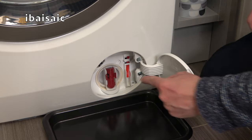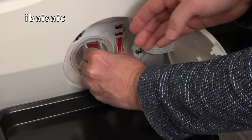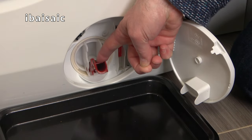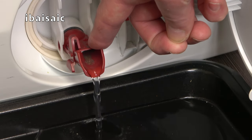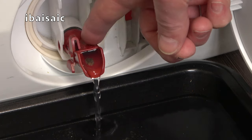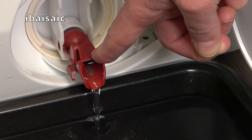On this particular model you'll see there's a red spout, so I just need to squeeze this together — two tabs — and then gently and slowly lower the spout and you'll see the water is starting to drain. I can see bits of sediment already. This machine's going to get a service wash as well, and I'll explain that during the course of the video.